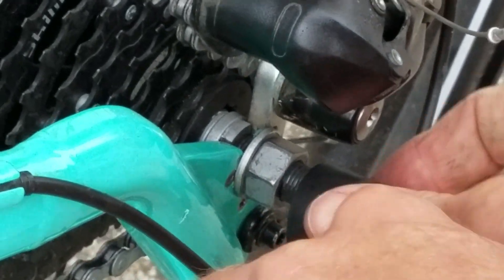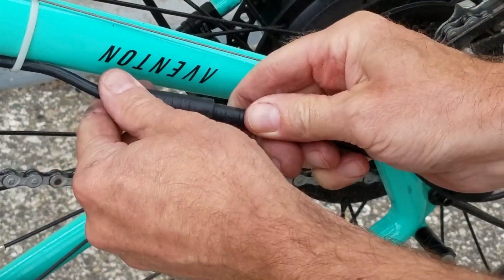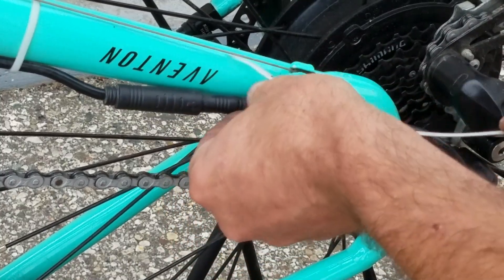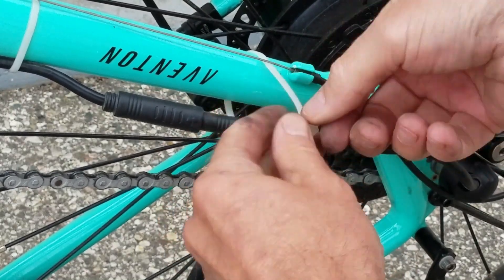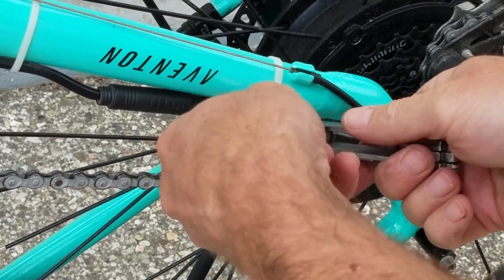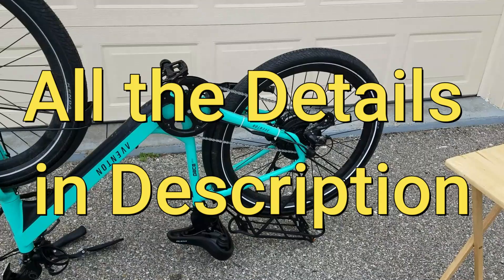Let's put our cap on. Make sure your wires are correctly aligned — there are arrows here. Align those arrows and put your wiring back together, then reattach your wire. Do not leave this thing hanging loose. I will take zip ties with me — it's just a perfect little tool for fixing things when you're on a trip. If that wire gets caught in your spokes or your gears, you've got more problems than a flat tire at that point. So get in there nice and close and snip it off. That is taking the rear tire off of an e-bike.